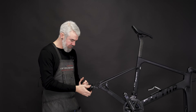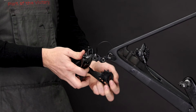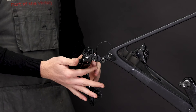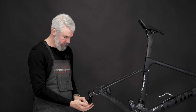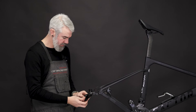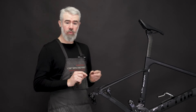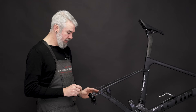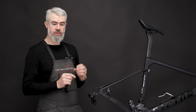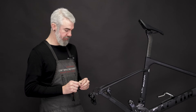And carefully, while holding on to the derailleur cage, wiggle away from the derailleur body and allow the spring tension to unwind. Now we can pull the whole assembly straight out. You have a spring, as well as a derailleur body gasket. For Ultegra or 105 models, you are going to reuse the stock derailleur body gasket. On a Dura-Ace model, you're going to use the included, slightly thicker derailleur body gasket that we ship with the OSPW system.